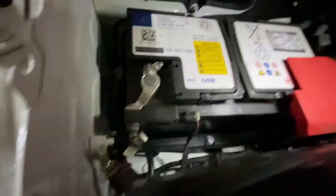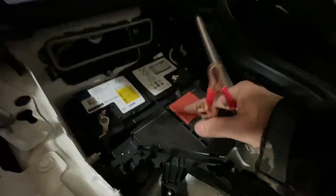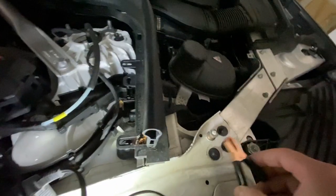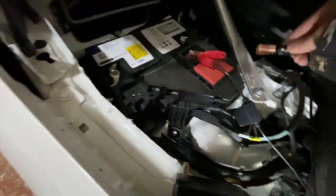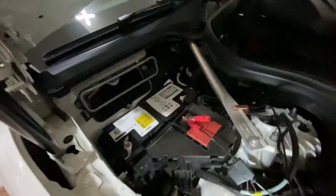This little retaining piece comes off the positive terminal. What I'm going to do is put a trickle charger on here. Here's the place where you can hook up the positive, and I'll put the negative to ground right here. So I've got ground and positive, and I'll plug the trickle charger into the wall. That'll retain all the settings in the computerized systems while I unhook the battery.